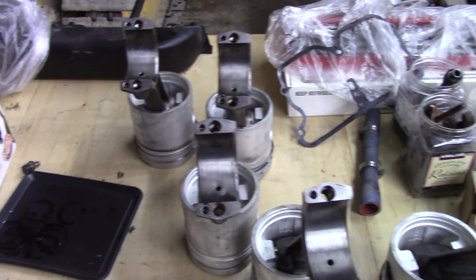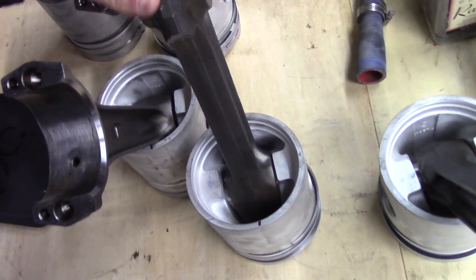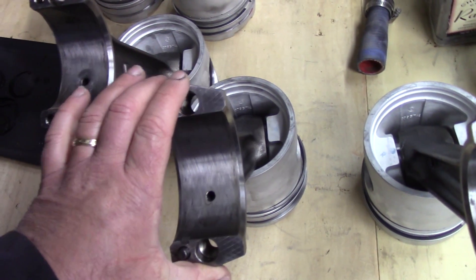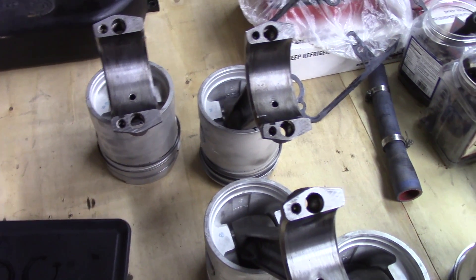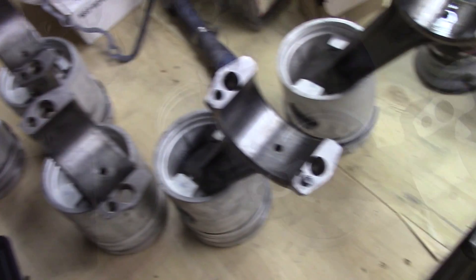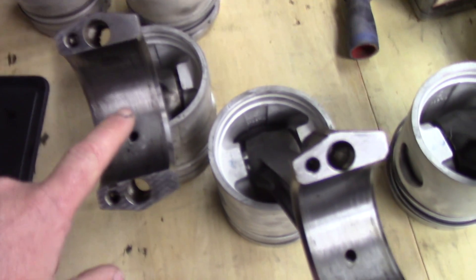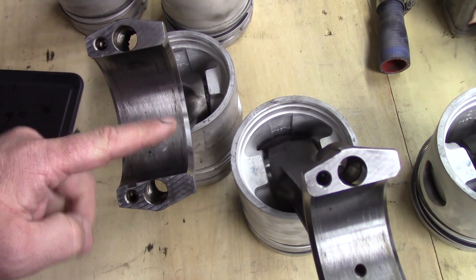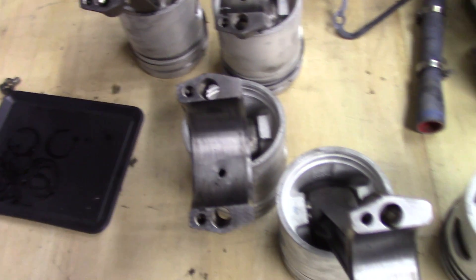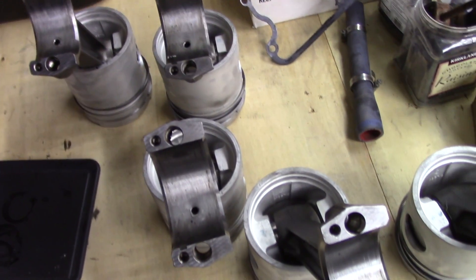Here's something to add fuel to the 'God only knows what happened in the motor pool' fire: this motor has been put back together with big cam rods. Apparently you can use big cam rods in a small cam motor, though you can't do the reverse. The small cam rods have the oil journal right there, and the big cam rods have it up here, so you can't use the bearing shells because they're going to block the journal — and that's not a positive development for the longevity of the motor.